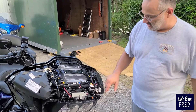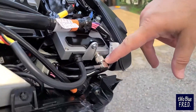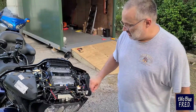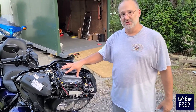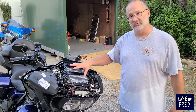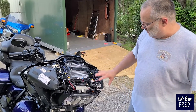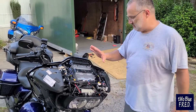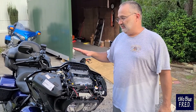The bracket that comes with the CB and all the mounting hardware still fits — everything works great. We slid it right in here. The original factory connectors and the antenna connector are still on the bike, they still work, and we've hooked it in. You do have to get the radio flashed in order to activate the CB on the 2020, which is different than the 2019 and before. But once you get it installed and fire it up, everything works great — antenna and all.